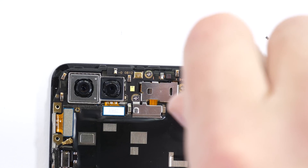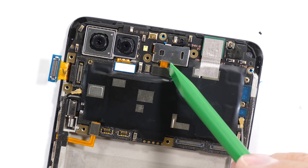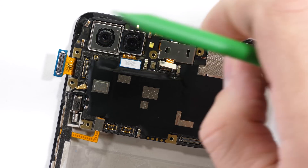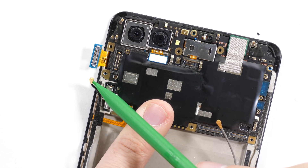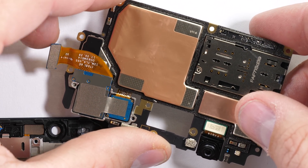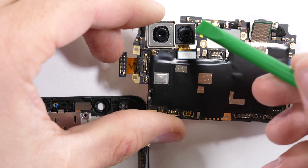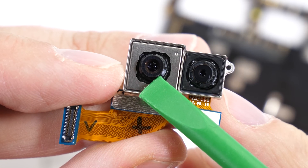The motherboard has an incredibly small eccentric rotating mass vibration motor tucked underneath the camera — you can see how it rotates and spins around on its little motor. I'll remove four more screws holding down the motherboard and unclip one of the two main camera ribbons over here on the side, just like a little Lego. Same here with the earpiece resting in the center of the motherboard. There are two wire cables, a white and a black, one on either side of the phone, then the motherboard can pull up and away. Looking at the motherboard, we get a close-up view of the SIM and SD card tray along with the dual camera setup, both 12 megapixel. Vivo doesn't advertise OIS, so this little movement in the lens might just be the focusing mechanism.